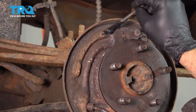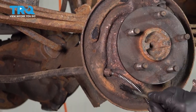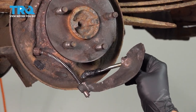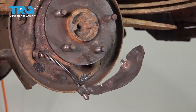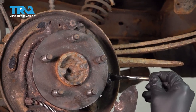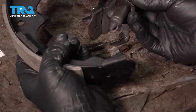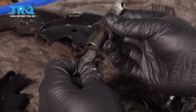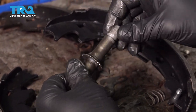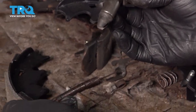I'm going to apply a little bit of grease to these contact points — just a thin coat. We don't want globs of grease because we don't want this to get onto our brake shoes. We also applied some grease on the inside of the adjuster, put some anti-seize compound on the threads, compressed it back in, and gave it a quick wipe down to make it easy to work with.